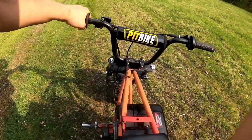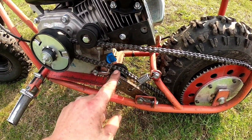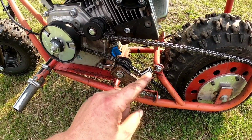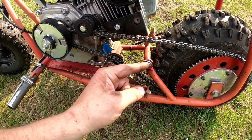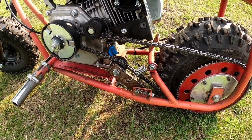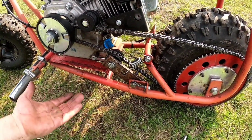Lost it. Alright guys, so what happened there was when I took the tension off of this and made my adjustments, I forgot to tighten this up right here. It pulled around and got just enough slack off of it when we were coming into that straightaway for the spring to lift, and it just made itself past the bolt and pulled itself under. That tells me we can do something different to make this a little bit better. Also, I could not forget to tighten the bolt.